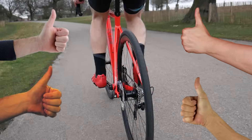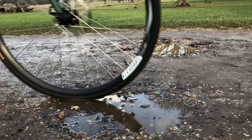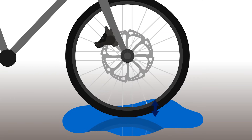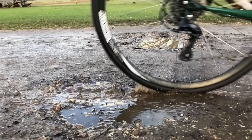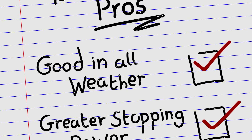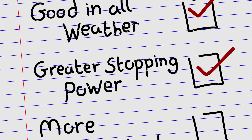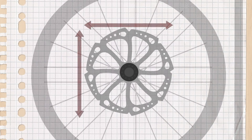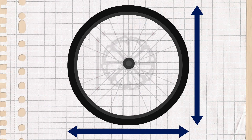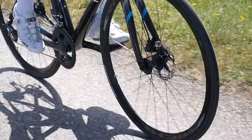So that's how disc brakes work, but why are they so popular? Well, there are a few reasons. Disc brakes work well in all weather conditions — the braking surface is further from the ground than rim brakes, the calipers are better protected, and the holes in the disc better displace water. Stopping power is greater than rim brakes thanks to the calipers, which can be made very stiff, and the fact that a disc is much smaller than the rim on a bicycle wheel, which means disc brakes bite earlier, giving more braking power during the initial application of the brake.